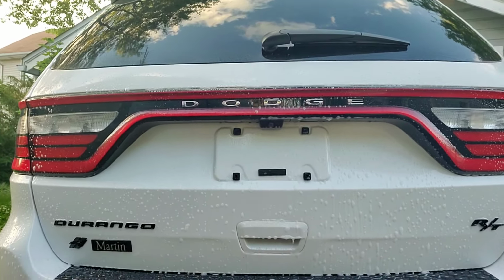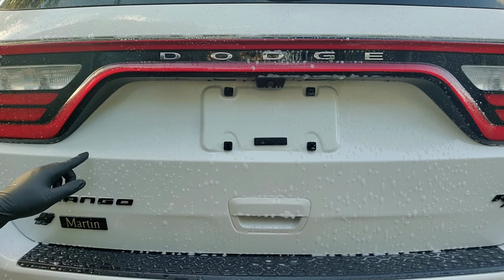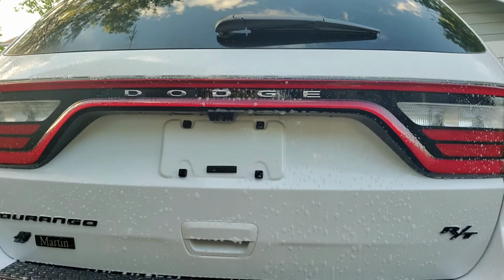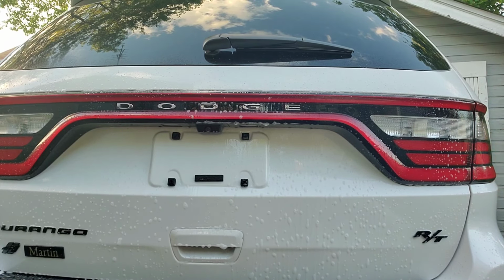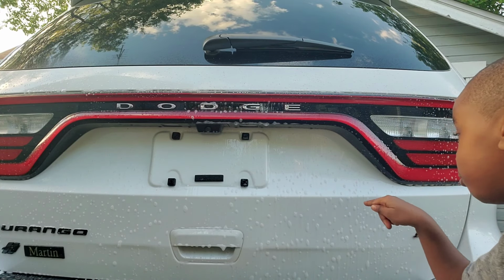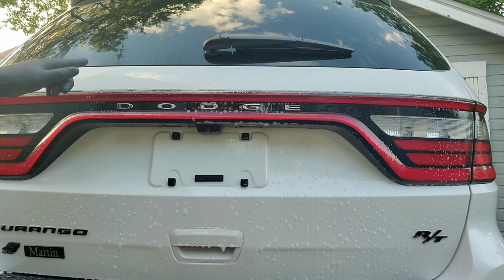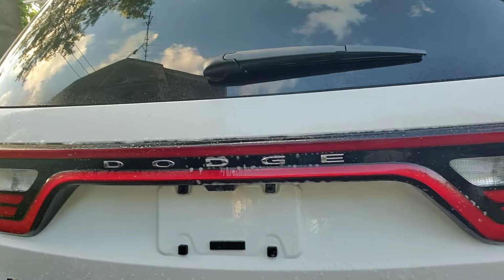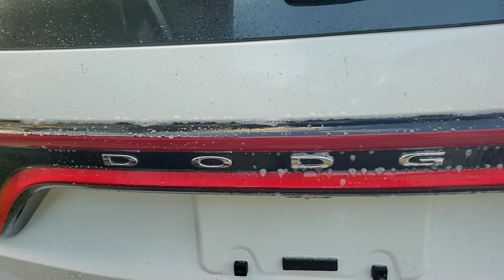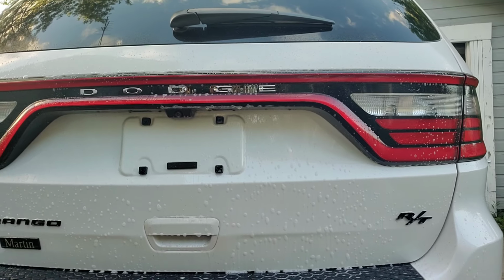Purple, as you can see, on the back of the truck. That's purple, right around in here. It's starting to react. All this is about to start turning purple. Point to the one you see. Don't touch this, just point to it because the whole camera's on. It was right here. That purple spot. So you saw that? Right there. And look up there, there's some purple. All that chemical is reacting to that iron. All the iron is turning purple.